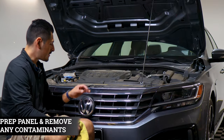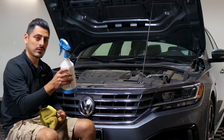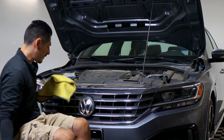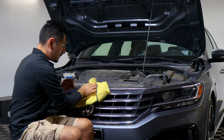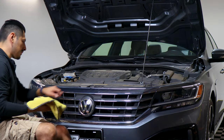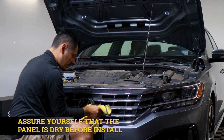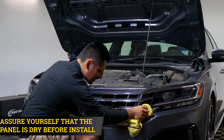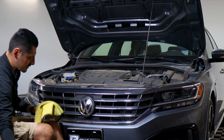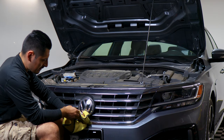Before starting with the installation we need to make sure we prep the grill. All you need is water and baby shampoo mixed together inside a spray bottle. Once you have your spray bottle solution, spray it onto a clean microfiber towel. You'll need to have the hood open to cover the inside of the chrome as well. Clean everything that has chrome, including the chrome on the side where the headlight is located. Once you're done cleaning, make sure everything is completely dry — if there's water residue left and it touches the adhesive side of the film, the film will have a hard time tacking down on a wet surface.